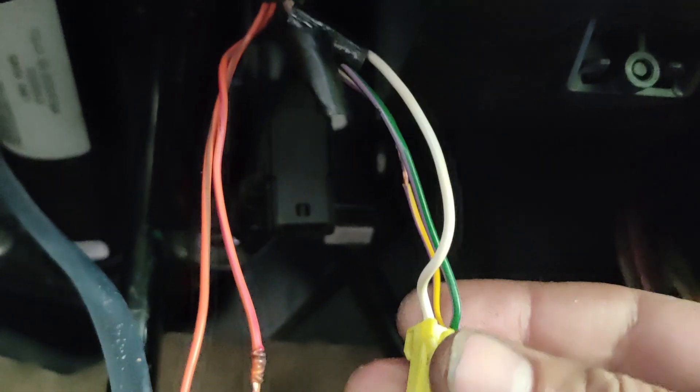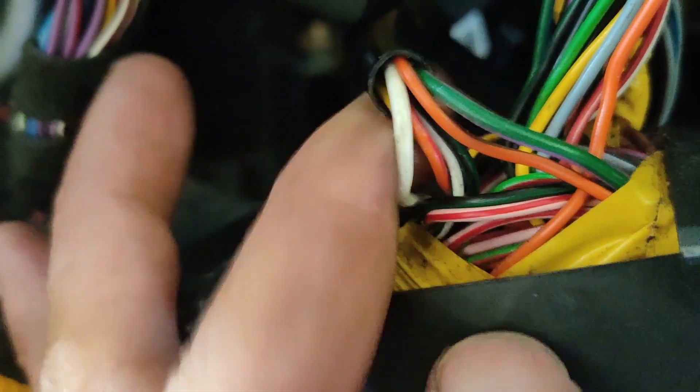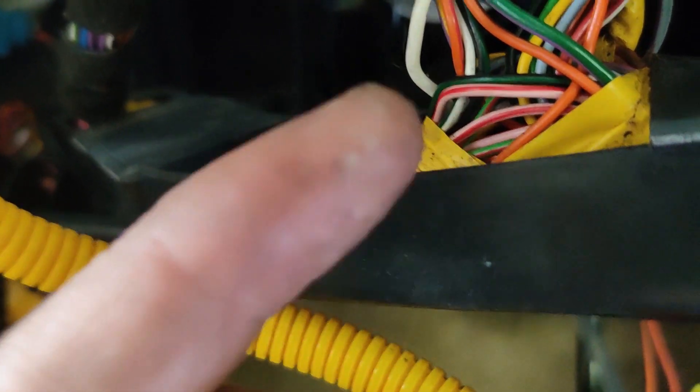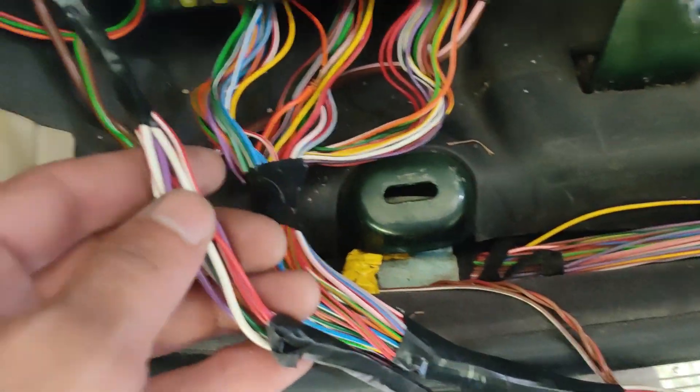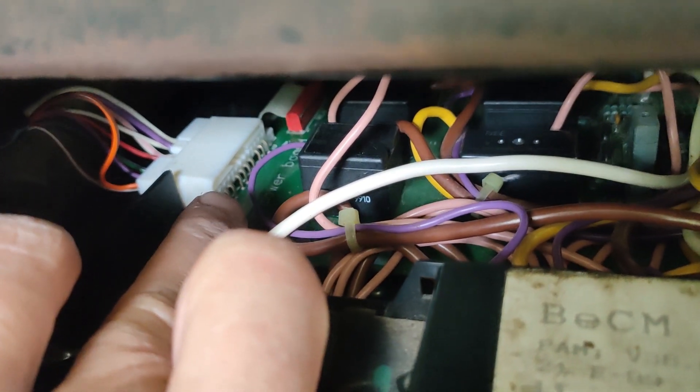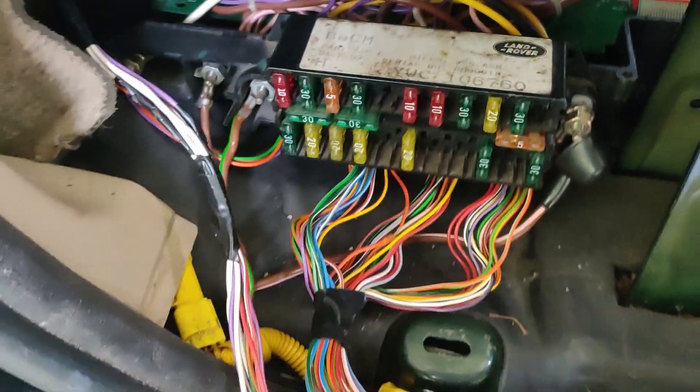Having ascertained via trying two different switches, it has to be something to do with this wiring. I'm just tracing from purple — the green and purple goes off that way, and it's the fourth pin on that connector there. I did a continuity test and it is not good.